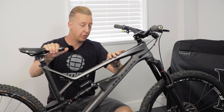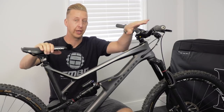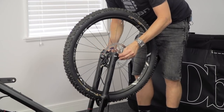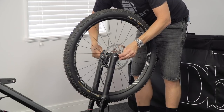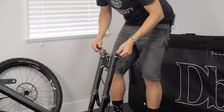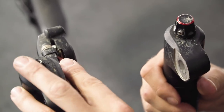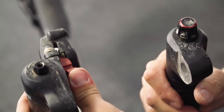The next step is to remove my wheels from the bike. I'm going to do this by flipping the bike upside down and resting it on the saddle and on the handlebars. If your bike has a computer or any protruding things on the bars, make sure you're on a level surface. I'm on carpet here so it's not going to scratch anything — just take that into account with your own bike. With the wheel out, get your pad spacers and put them in between the brake pads. This is so if your brake levers accidentally get actuated without the wheels in, you won't have to mess around with those pistons at the other end. It means your brakes will be in exactly the same state as when you packed the bike.